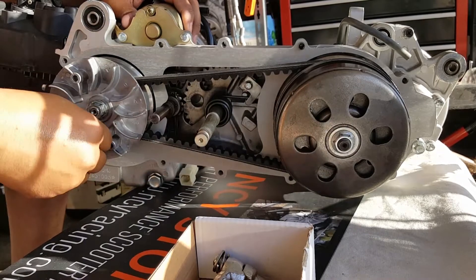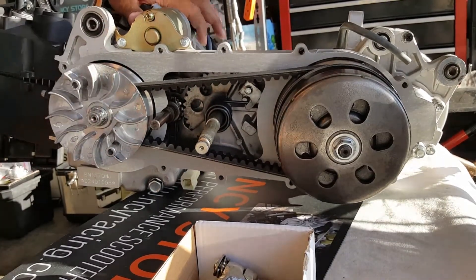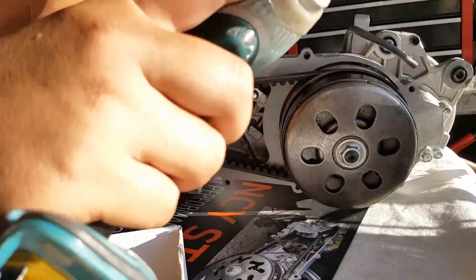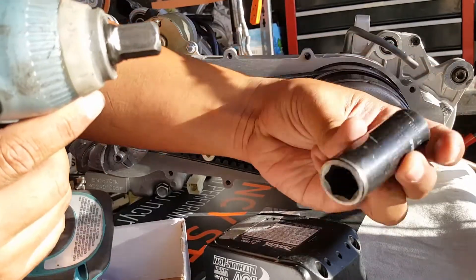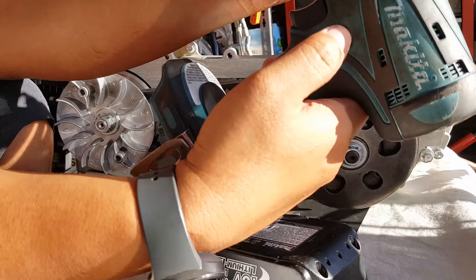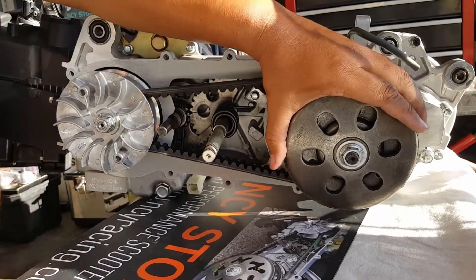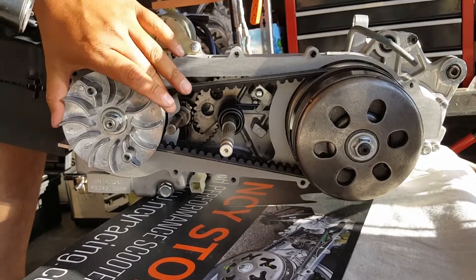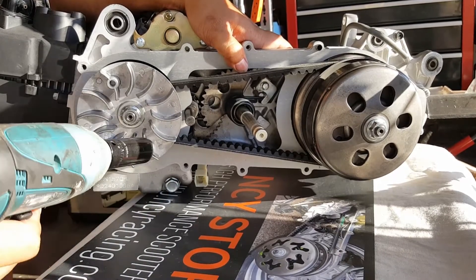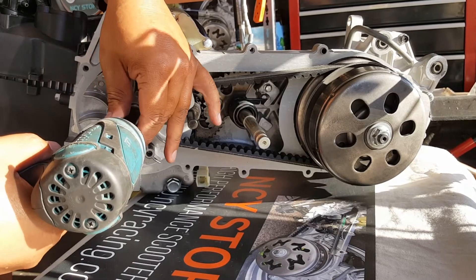This next part requires a high-impact socket to remove it. Here's our high-impact socket — they usually have a very thick, almost hammerhead-style build. It's going to need a 17-millimeter socket. We set it to reverse — that's when the arrow goes backward. This beats having to stick something in to hold the variator. This is the variator clutch and this is the variator itself — you can take either off first. We're going to take off the variator first. This is an impact wrench — watch what it does: it hammers and bounces back and forth rapidly before actually removing the bolt.